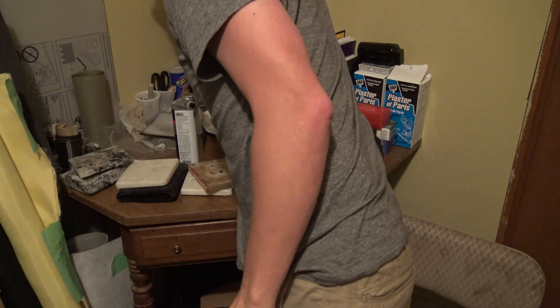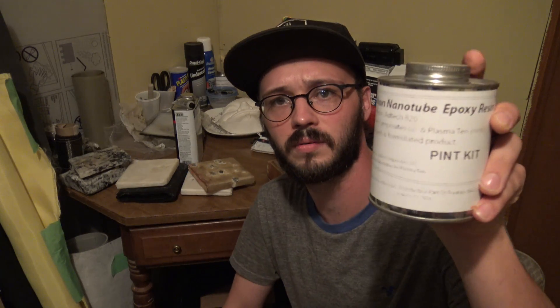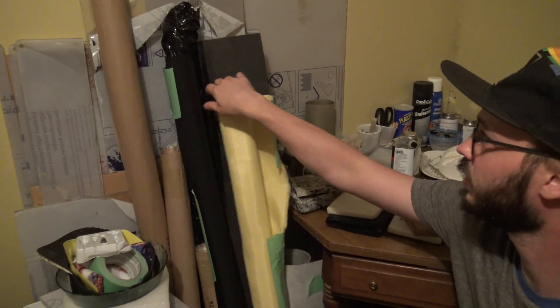You could use some of that — I do have some of this AdTech nanotube resin, which I was saving for a ballistic face mask that I'm currently designing. But if you're going real simple, that Bondo resin by itself is right around 12 bucks. I even used the cheapest fiberglass — not chopped mat, it is actual fabric, because there is a difference between those two. Chopped mat is usually for building up body, whereas fiberglass fabric gives more structural support. If you want high tensile strength, you'd use fabric.